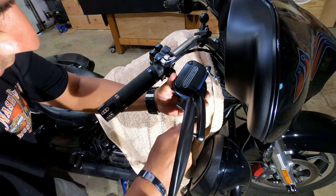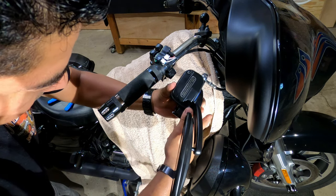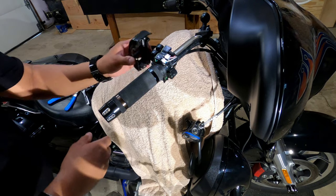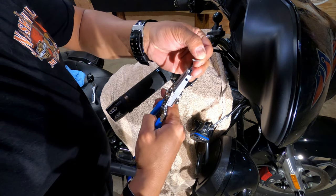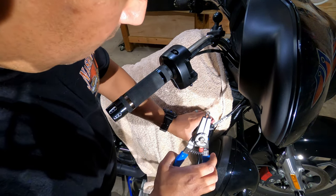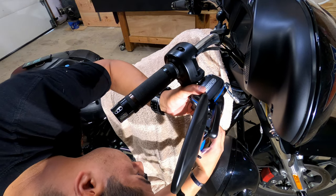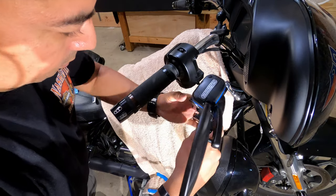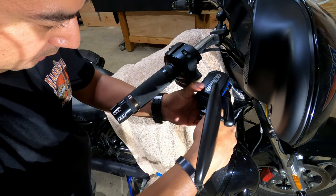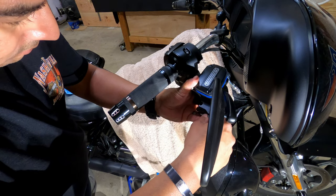The front just slides right in. Align your holes and get that retaining pin back in there. Make sure it's aligned. Then get your retaining clip — don't over-extend it because you're reusing it, so you don't want to stretch it too much. Get yourself a good angle and make sure you get it in that little slot. It should go in nice and easy. If you hear that click, it's seated, and your pin won't come out.